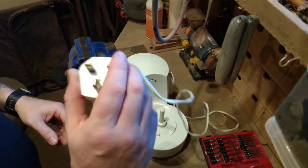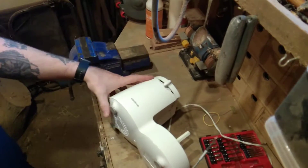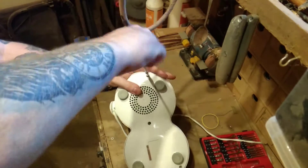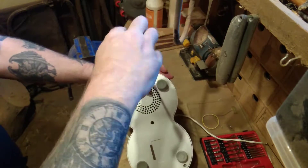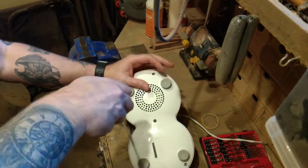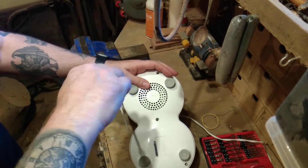To change the drive belt, all you have to do is undo the bottom of it — but first make sure it's unplugged. With any electrical item, make sure it's unplugged. With this one it's just a few screws in the bottom. Of course, had I not broken it I wouldn't be doing this now.